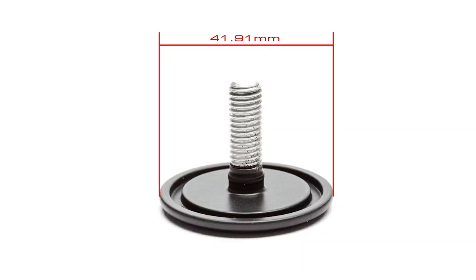The outer diameter of the widest point is exactly 41.91 millimeters, and the inner diameter of the groove that the o-ring sits in and seals is exactly 31.25 millimeters, meaning it should work with just about anything that has a hole in the glass or the trunk that's smaller than that. So unless you already have one of those fancy things that looks like a lightsaber swinging around on the back of your car, you should just ditch that ugly useless rear wiper and buy one of these.